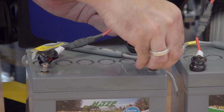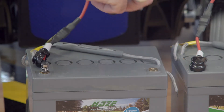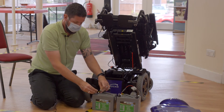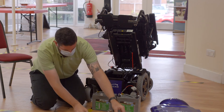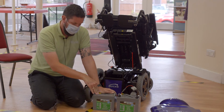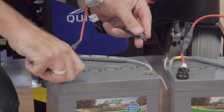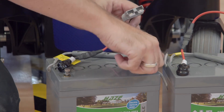Remove the bolts from the top of the battery, keeping hold of the washers and the bolts — this is another fiddly job and you may find you drop the bits. Once you have your connectors, lay them to one side, bring in your replacement battery, and fit them in reverse: red to plus first, screwing them in a few turns to make sure they're locked in place, then black to minus, same again.